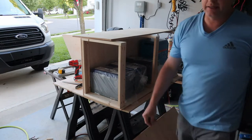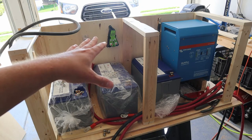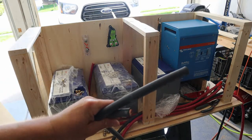Just staging the batteries, the inverter, the battery monitor, the lithium ion battery monitor, fuse, and a few things. Coming out of this box I want outputs for DC, outputs for AC from the inverter, and a chassis ground and positive running to a second box where all the other stuff will be installed — like the charge controller and shutoffs. I'm building two boxes to keep things modular so I can take one box off the top of the other. Right now I'm making battery cables out of 2/0 gauge cable — pretty beefy.